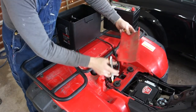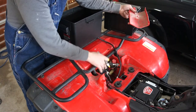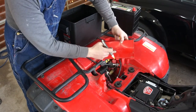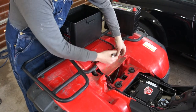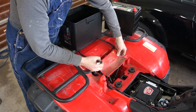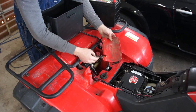This ATV has a plastic cover that sits here and covers the battery and part of the electronics, so you can remove it and get access to the fuse panel. I've already modified it once — I added clearance for an auxiliary fuse panel I put in a couple of years ago. So I'm going to cut some slots or notches in it. I just drilled those out with a hole saw and then snipped them straight with a pair of side cutters.